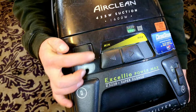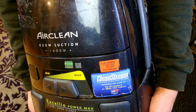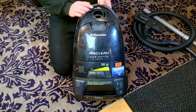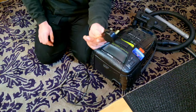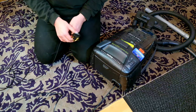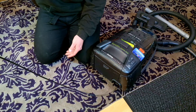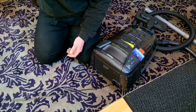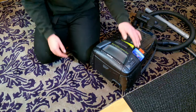We have a power socket, adjustable controls. We have — ignore the DJM domestic sticker — but the CleanStream vacuum cleaner filter: Gore-Tex. I remember loads of manufacturers jumping on the Gore-Tex bandwagon to obviously try and stay relevant in the increasingly bagless era. We have automatic cord rewind — obviously had a new plug at some point because this would have had a moulded one, but it's black. That's a very nice action with an automatic brake. To wind the cable back in, you flick that switch and it slowly does — it might need attention. That puts it into the insane annoying mode that the Electrolux 4x4 had. Didn't really like that system at all.